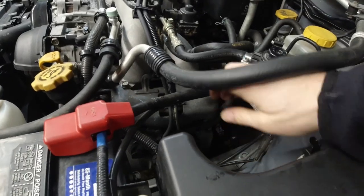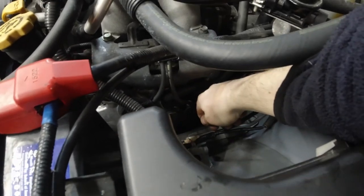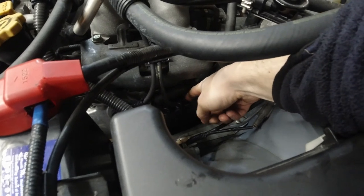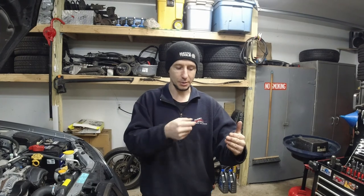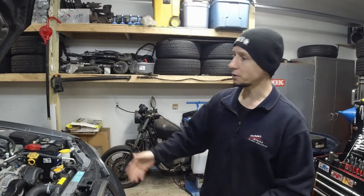No more cold misfire. While the car was running, I simply took the cable off and I had spark coming out from the side of it. On these cars, the actual rubber boot that goes inside where the spark plug is, it's like this long. The spark was coming out right underneath the cap — so it was misfiring. I replaced the wires and that relay — two problems solved.